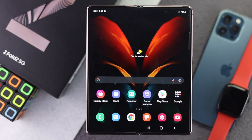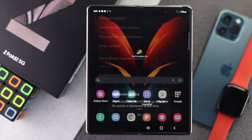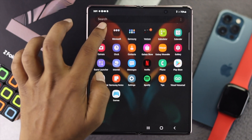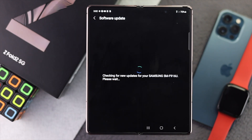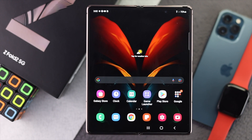If you're still having a problem with your microphone, check for a software update for your Samsung device. A new update can help fix minor bugs. Open Settings, scroll down to Software Update, tap it, and tap 'Check for software update.' If a new update is available, go ahead and install it.